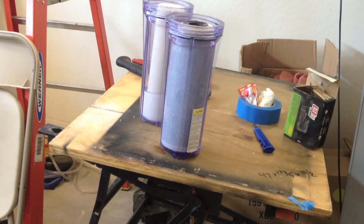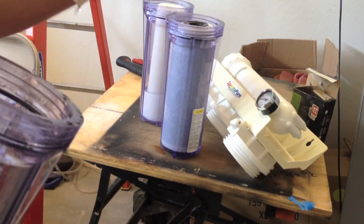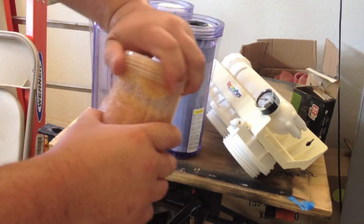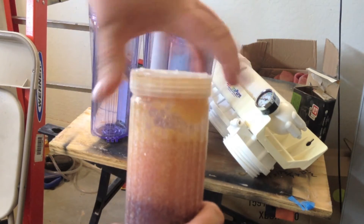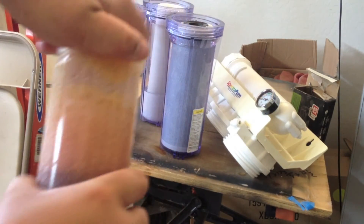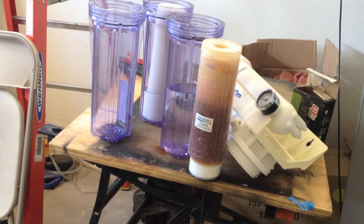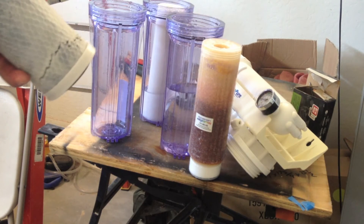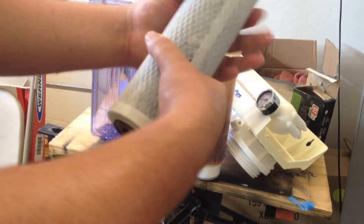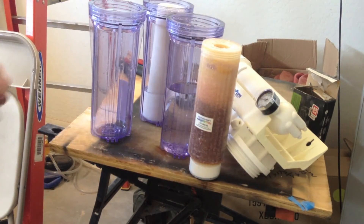Here's my DI chamber — and here's my DI resin. You guys ever notice that DI resin smells like shit? Here is my cartridge and this is how we're going to change it. There are threads on the bottom. I'm going to take my carbon block out, inspect it — and the carbon block looks good. What I'm looking for is discoloration and deterioration of the actual carbon block. It still feels pretty solid and it's not dirty, so this will be getting reused.